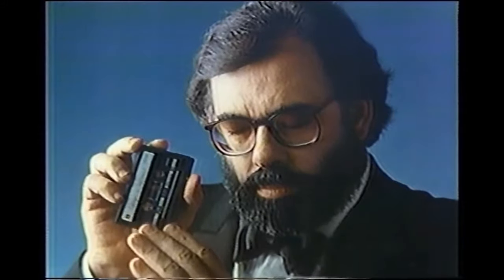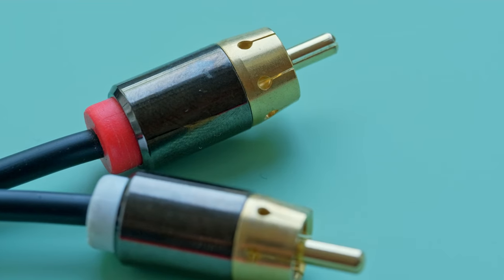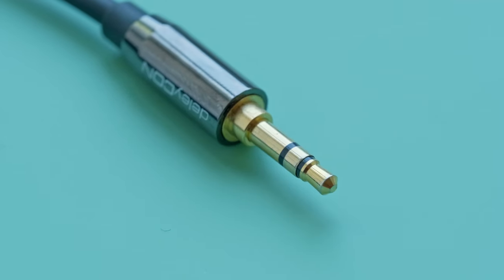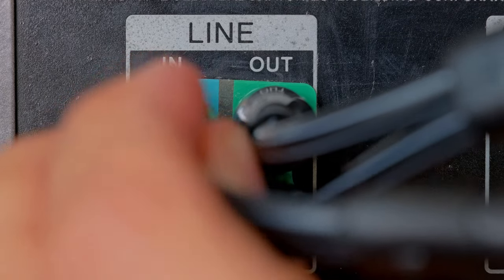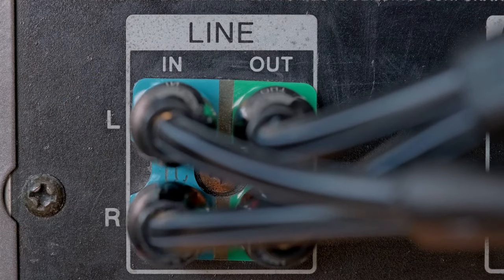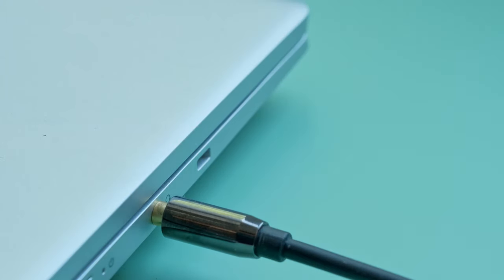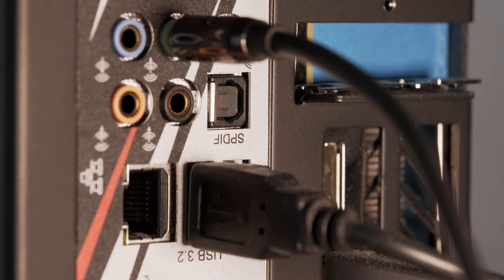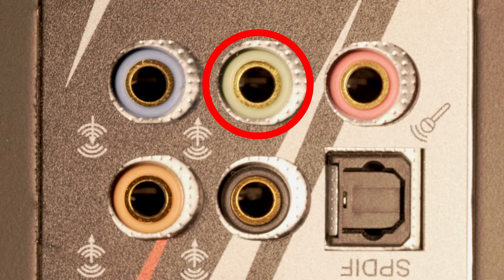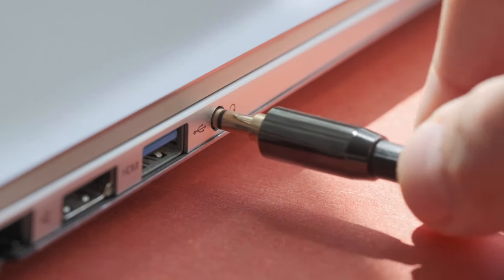You will also need just one cable to feed your recorder from the external audio source. If you have a deck, you will need an RCA to mini jack 3.5mm cable. Connect the white and red — or black and red — RCA plugs into the input port on the back that reads 'in' or 'line in', and the mini jack into your audio device. If you want to plug it to your PC, use the same port as you use for your speakers — it's usually green and might have a headphone sign. You can also connect it to any device with a 3.5mm mini jack port like a phone or tablet.